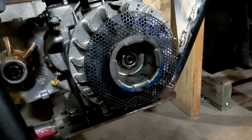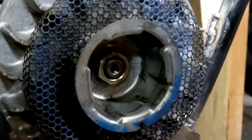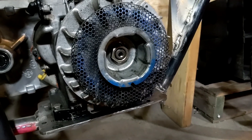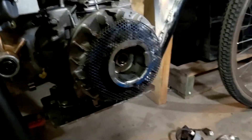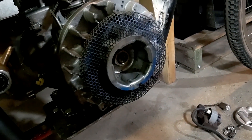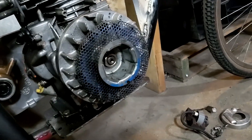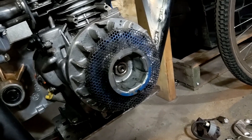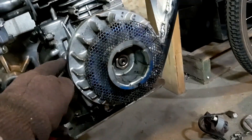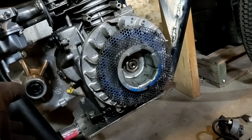As a nice little added bonus — I don't know if you guys can see this — but this flywheel gave me just enough threads for the original nut to grab on the crankshaft. I'm still going to put that bolt on just to make sure, but it's awesome to have this more secure and with the original hardware again. It must just be about an eighth of an inch, maybe three sixteenths, a little shallower where the nut goes, and that little bit made a big difference.